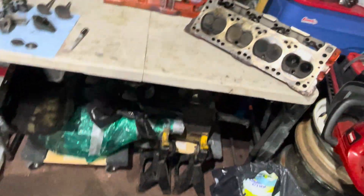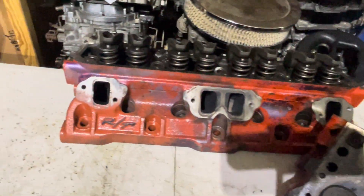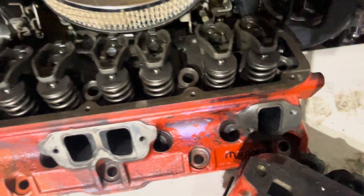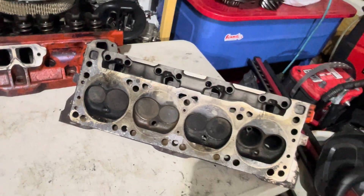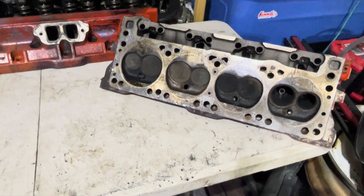That's what it looks like on the graph. All in all, I think these heads are gonna be a nice little upgrade — bolt-on, takes factory springs. They use eight-millimeter valve stems, and they had positive valve stem seals — viton-style eight-millimeter positive seals.